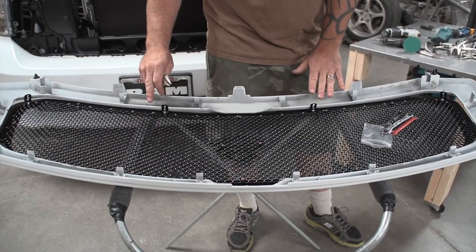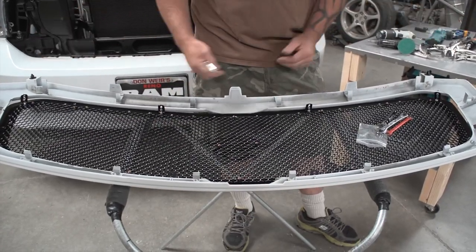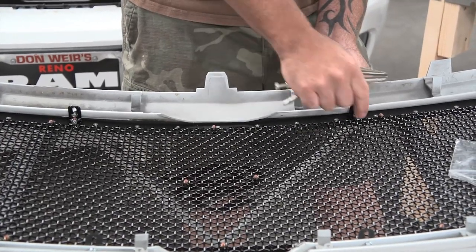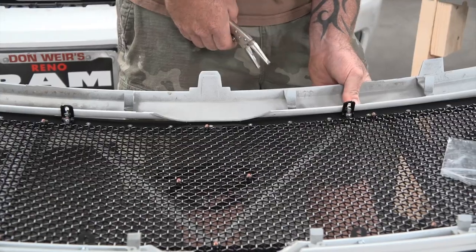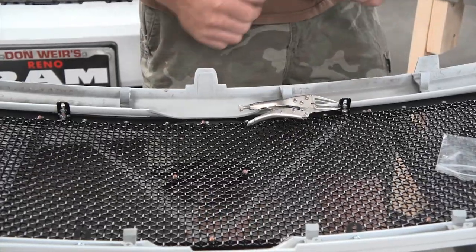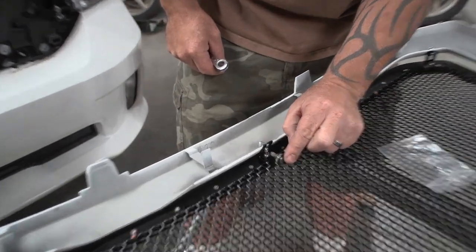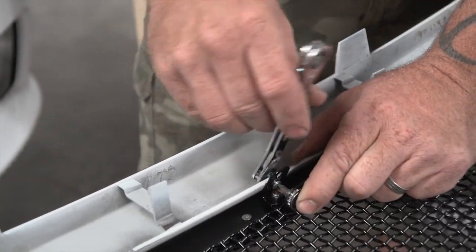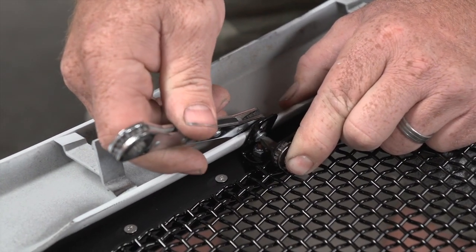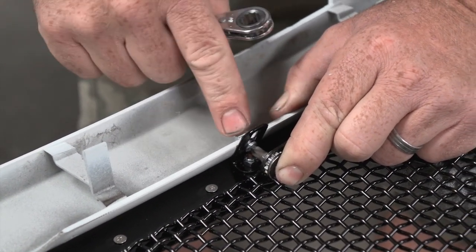Now that all the hardware is loose fit, we're going to start with the center brackets, tighten those up first, and work our way out. You want to make sure that the grill is push tight to the shell and then tighten. If you need to, pull it tight, clamp to the side, and then tighten your bolt — do that around the edges. On the tight ones, I like to use just a little ratchet with a screwdriver bit; it fits the hard angles a little better, and then you can use a ratchet on the outside. Just snug them up, don't over-tighten — this is just plastic. These are nylocks, so you have no worries of them backing off.